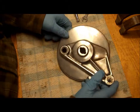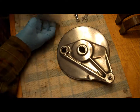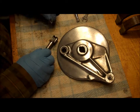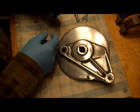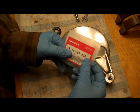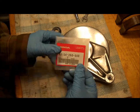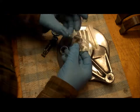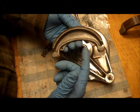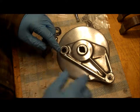I've cleaned this all up and I've given it a nice buff and a polish, and I've got all the parts ready to go. So let's crack on. The first bits we've got are the actuation pin, then a nylon washer, then a gauge washer, which we'll explore in a moment, and a felt washer. Here's the part number. If it's unclear in the video, I will put it in the description. We've then got springs for the brake pads, and the old brake pads are perfectly serviceable, so I will be fixing those back in. So the first thing to do is to assemble this end.